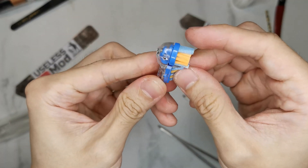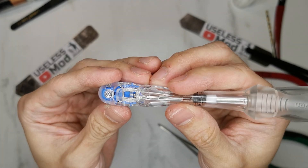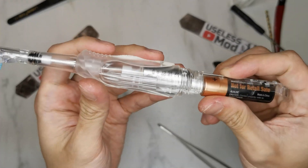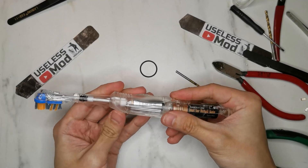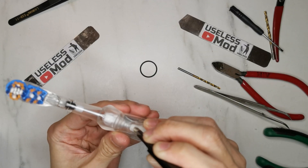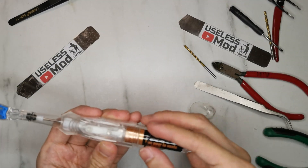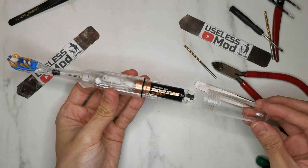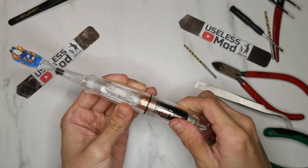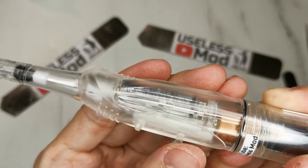Put the pin, the spring, and the brush back into place. Check that both brushes can move freely, then put the whole brush back. Put the whole motor assembly back into the case, and then I stick a small piece of acrylic in order to push the on-off switch. Finally, put the waterproof ring back and screw in the battery cover — voilà, all done! The on-off switch works perfectly.